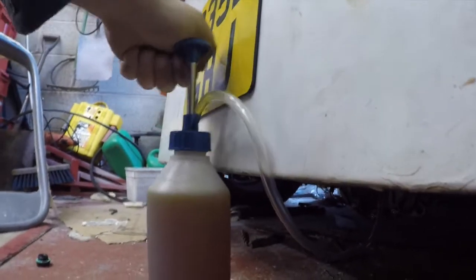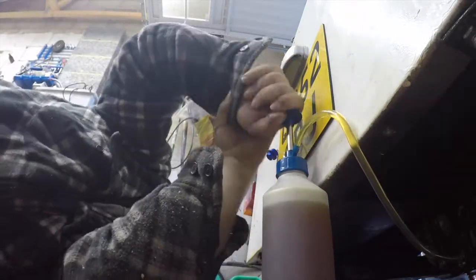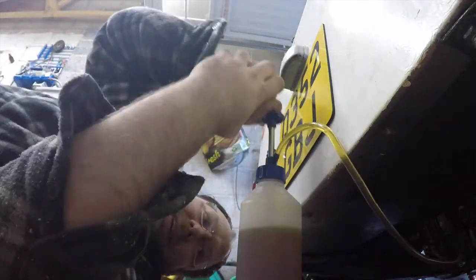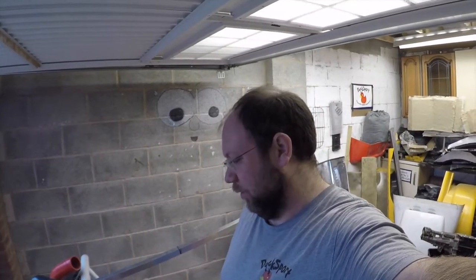and now I've just got to pump it in. So after the various bits of spillage that's inevitable when you're doing that job, I reckon I've got about 1100ml of the oil into the diff, so that's fine. That's better than nothing that was in there. We'll need a top up, I think, when I put that rear mount in, but I'm not doing that yet. I need to crack on with more important things for now than running gear when I haven't even got an engine back yet.